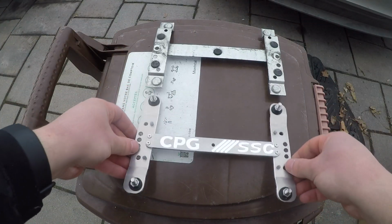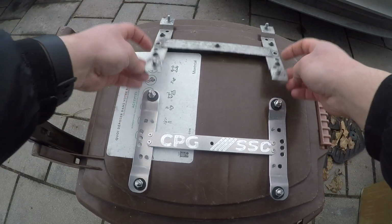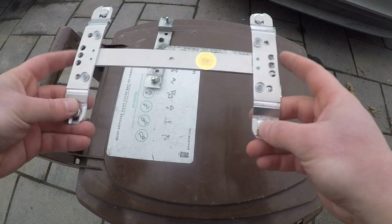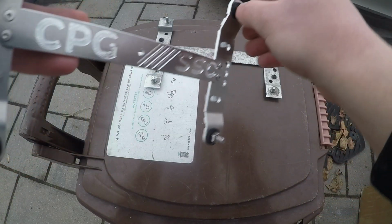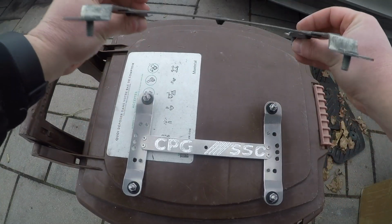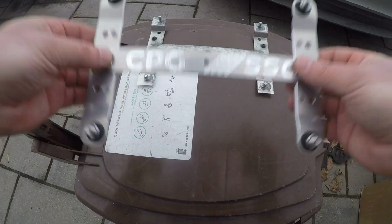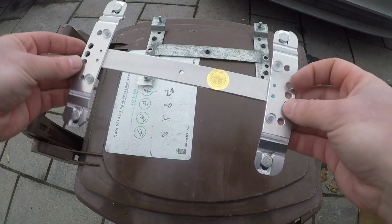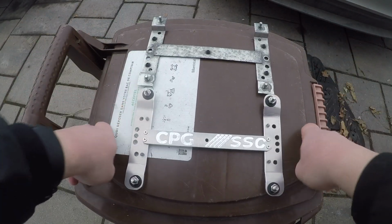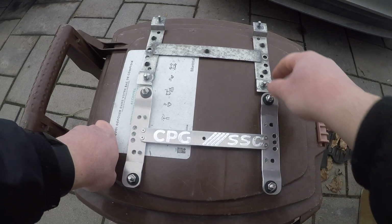And then over here, you can also see how it mounts. These are actually pressed studs, and then these here are screws which move around. So if at any time this were to strip or get damaged, these are easily replaceable, whereas this you might need to change the whole entire bracket. So that's kind of the benefit of this part, and plus it'll last way longer, especially in poor conditions. This will perform very well, and you might not need to ever change it once you buy one. So it'll pretty much last as long as your old Volvo will, of course. So that's the whole goal with this.